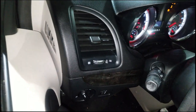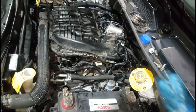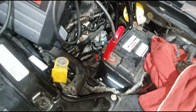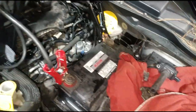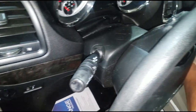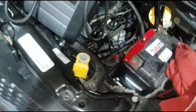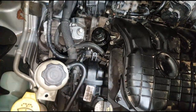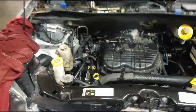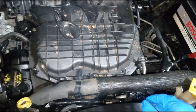Battery's dead ladies and gentlemen — I gotta get my jump box. Let me go grab it, we're gonna jump this thing up and fire it up. All right, I'm back — it only has 8 volts. I have my jump box on it at 12.8 volts. Let's fire it up and see what's gonna happen. Here we go — come on baby! That's that sound engines make when they haven't run in a while. Oh, it's running! Wow wow wow guys — but I hear a tick.